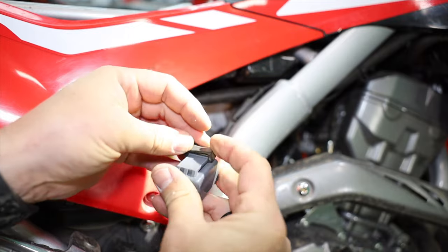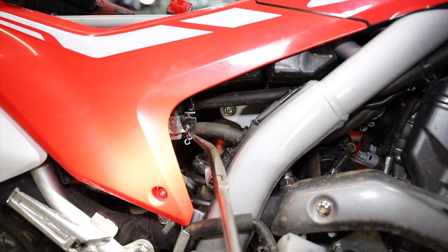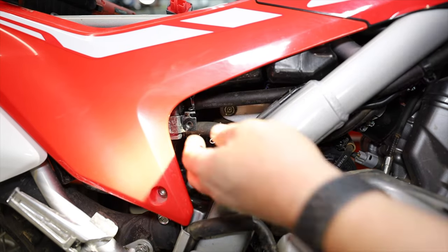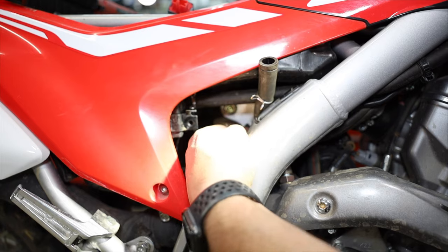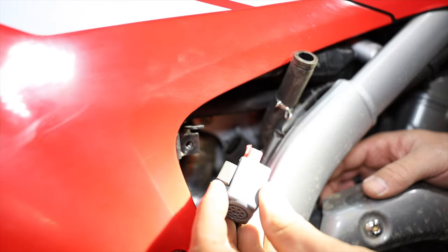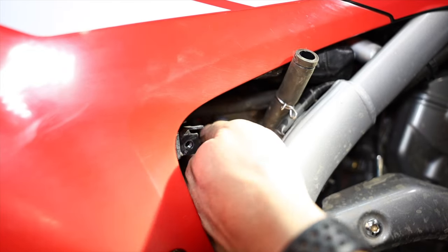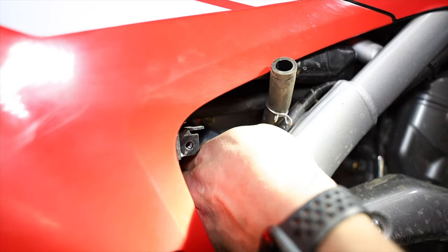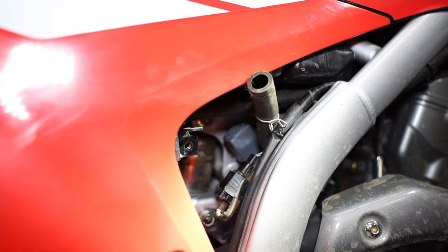Here's our relay in that little rubber bracket. The lip is going to go back on those prongs in there. I'm going to take this rubber hose off — it's not a fluid hose — to get more room to move around. Now you can see what we need to plug the relay into and where to put it. Start by trying to plug in the relay first. Once you get your second hand out of the way it's actually fairly easy. Getting the rubber boot on there went very easily as well — that rubber boot just slid right on. New relay is plugged in.